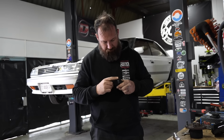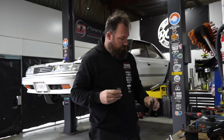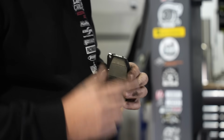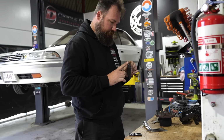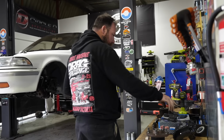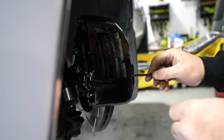I generally don't lube stuff up much on brakes, but DBA specifically have supplied this grease and even showed you on the bag where to put it. That's interesting, because where you're putting it now I would think is somewhat controversial, because that could potentially leak onto or get in the way of the braking surface and the pad. So minimal though, like there's literally a smear, that's going to burn off. If it were to get onto the pad surface, no one's going to die over it. Yeah, cool. That's what we want to hear. Well, hopefully most of us want to hear that.